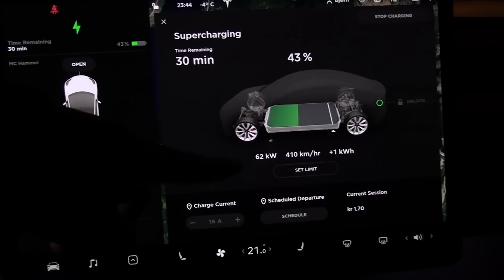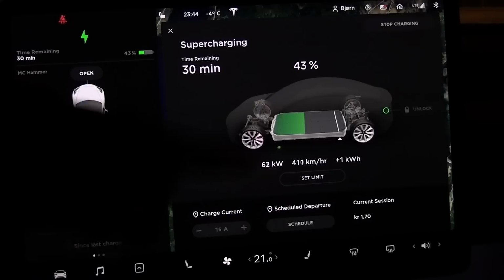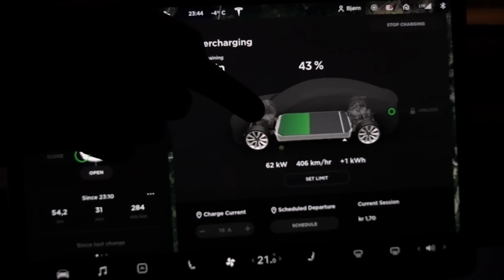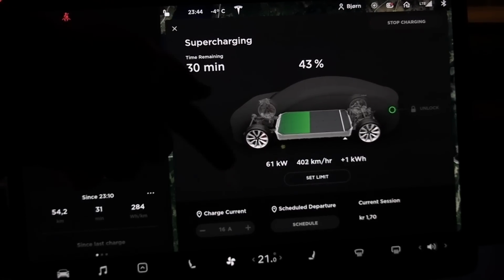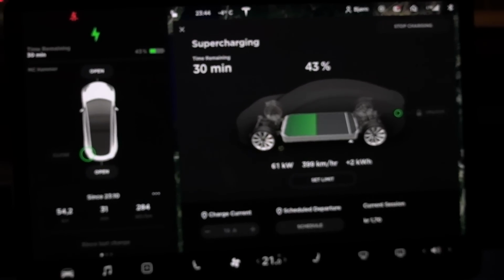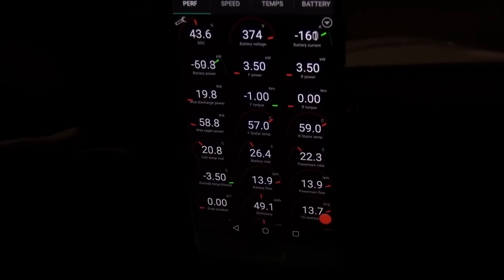So that's why you're charging slow. And also, why did it drop now suddenly? Why it was 70, right? And why did it drop? Simply because, like I told you, the higher up you go in percentage, the slower you can charge. It could take faster speed in the beginning, but because state of charge went up, then the BMS said, sorry, only 60 kilowatt now. The battery, you see, this is also the problem. The battery doesn't heat up that fast.